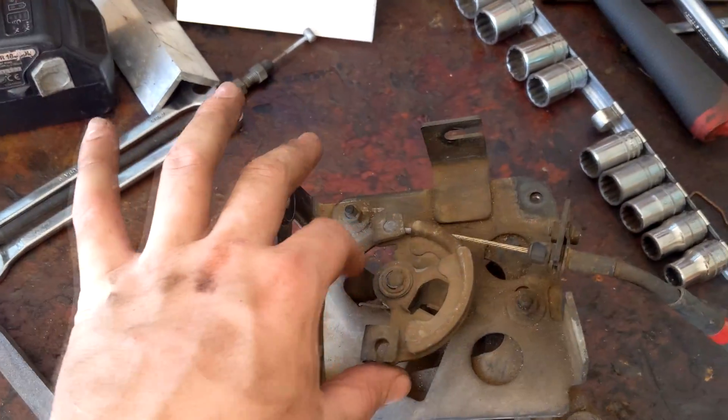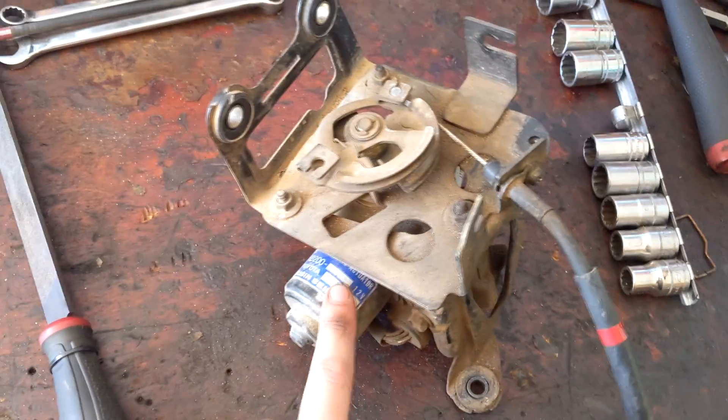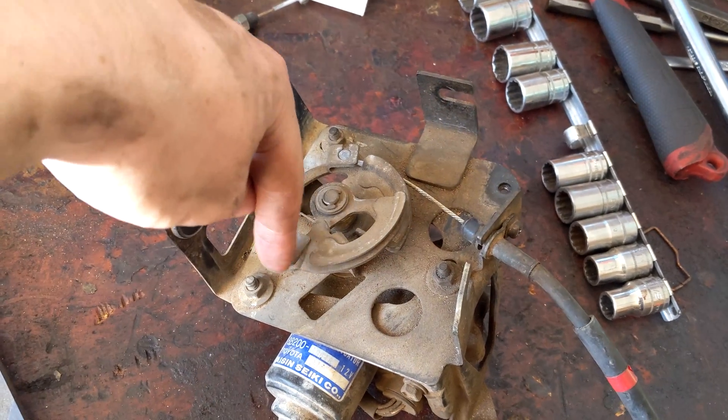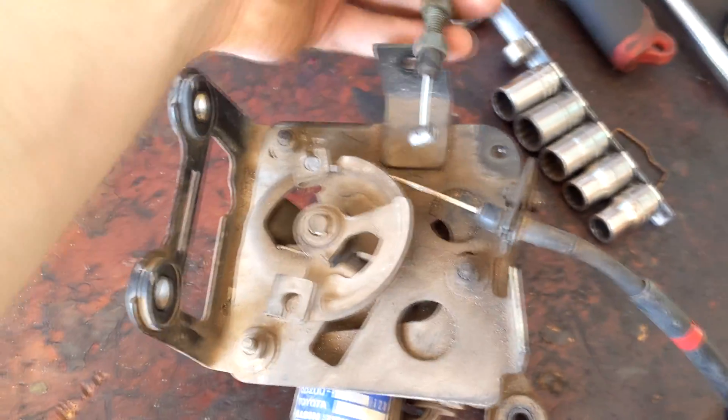So we're going to have to find a way to graft this cruise control motor to the FTE pedal. This is the cruise control motor here - it's just an actuator. This one here is where the old throttle pedal used to come in, and you can see the cable used to go from here to there. It was a nice little short cable, just this one here.